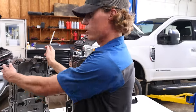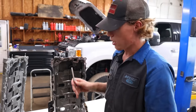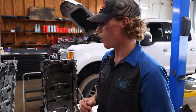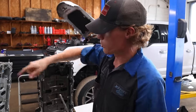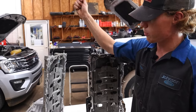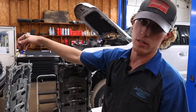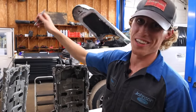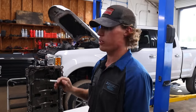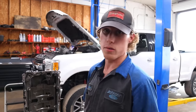So this is just something I wanted to show you. I thought it was interesting — something I've never seen before. I hope nobody ever sees it again because quality control should be better than this at the manufacturing process. From now on, when I'm doing upper oil pans, I will be removing these plugs. This is a threaded insert plug right here on the end of this pan. I will be removing this plug and shoving my magnet in here, making sure that it goes all the way through, because I do not want to have to replace any more of these engines. I've done probably 50 or 60 upper pans and never had this problem, but here we are. I'll never do another one without pulling the plug.